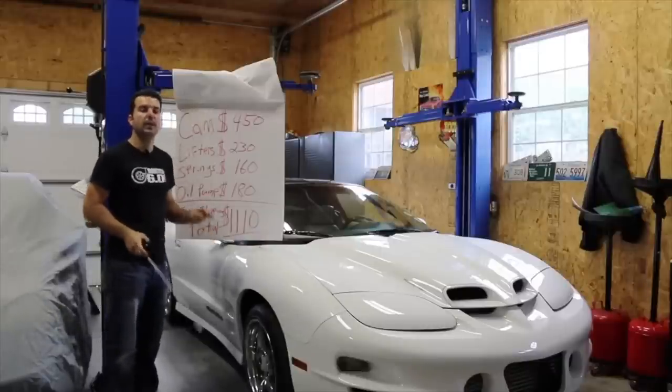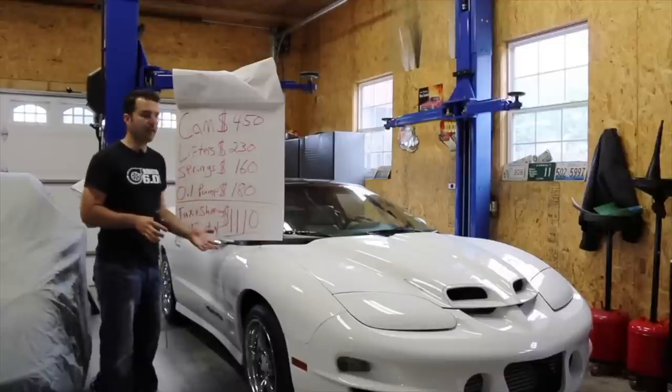If you have any questions about our builds, comment below — both Will and I love talking cars and will get as specific as you want on money, exact times, and horsepower numbers. Will's car hasn't been on the dyno lately, but at 3,900 pounds and 148 mph trap speed we estimate around 1,000 wheel horsepower. Last dyno he made 840 at 16 pounds of boost and 16 degrees of timing; now he's pushing 20 degrees and 20 pounds, going up to 22 next session.